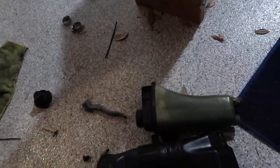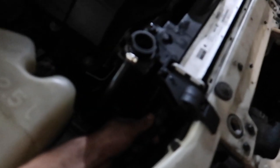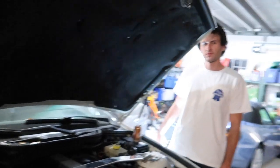For this S54 radiator, the sensor goes right where the old one did. If you buy a new one, there'll be a brass screw holding a placeholder for the sensor. Pretty easy stuff — bolts all right in. Tighten all the clamps down. We flushed it about three times; the coolant's now crystal clear on all flushes, so we know when we put in new stuff it'll be 100% clean and ready to rock.